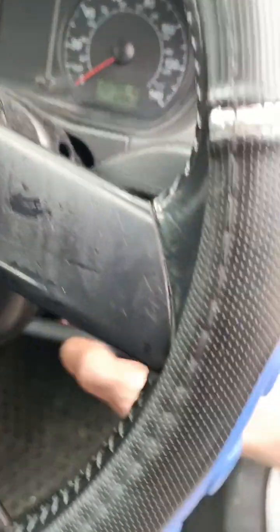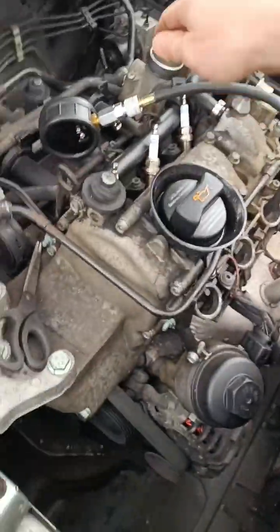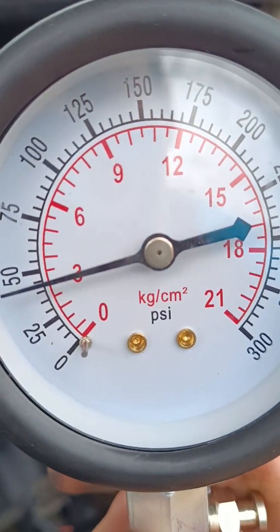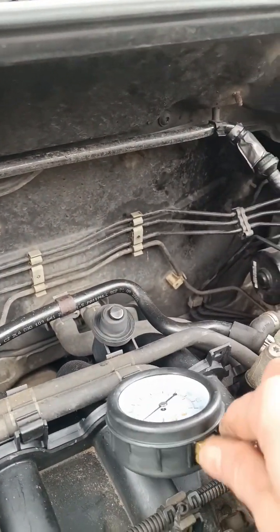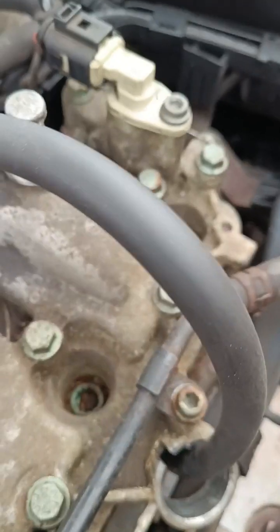That's the engine light — probably. Don't know if it has been leaking, but I think I've got to put gasket sealer on the oil sump. So that was eight seconds worth. Cylinder three is right down. If cylinder three is that far down, it looks like it's going to be the piston rings, which is what my suspicion was.